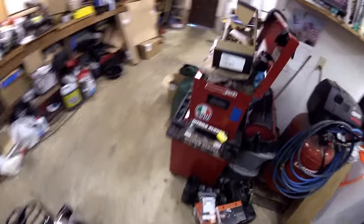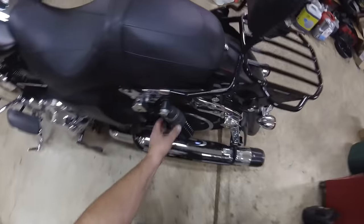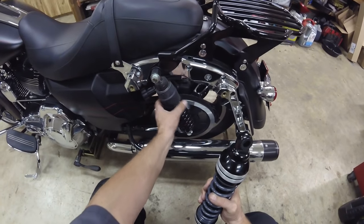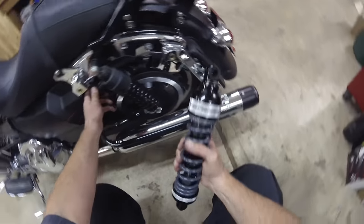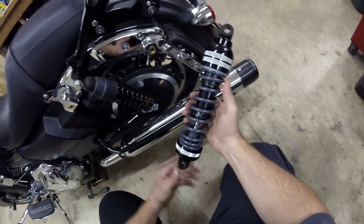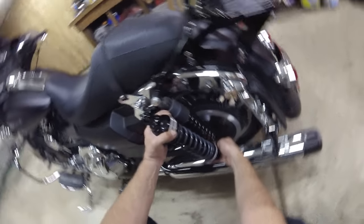Okay. So, these are 13 inch 944s. Just give you an idea. This is the one shock that adjusts, and it hydraulically adjusts the spring pressure. It's got a hydraulic sleeve in here that compresses the spring. Very, very sensitive shock. But you can see, you know, she's only got about an inch and a half. It's probably got 2 inches with the bump stop. And of course the bump stop on this thing is sitting way up on the shaft. But you can see, going eye to eye, this is an inch taller shock.